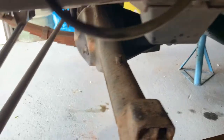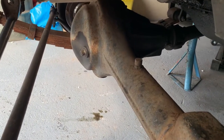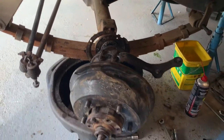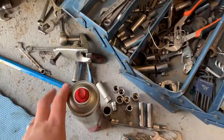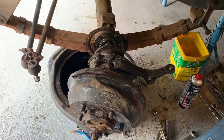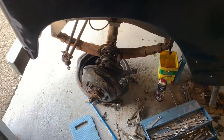I just need to knock these little lock tabs off, pull the steering arm out, and that should let me separate the swivel housing and the brake back plate off the chrome ball and also get the shaft out. I've drained the oil from the differential, hence the stain on the floor. Went down to the motor factors and bought quite a lot of brake cleaner just to take some of the gunk off before removing it and putting it on my nice big cardboard sheet.